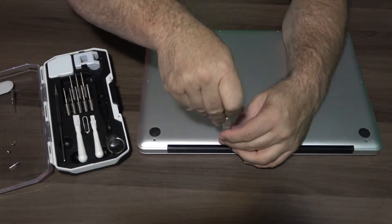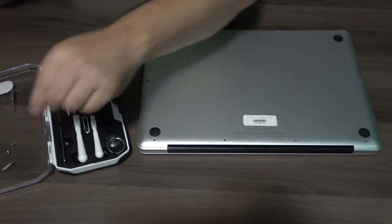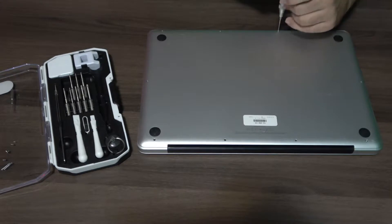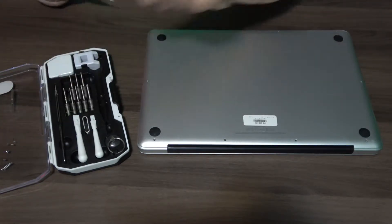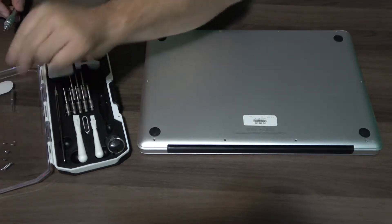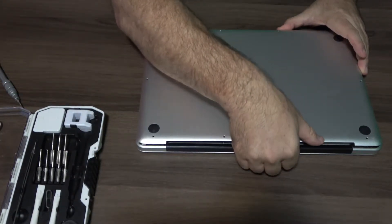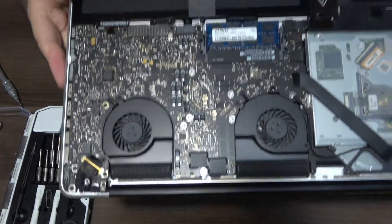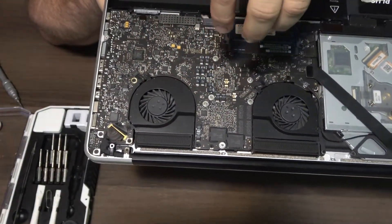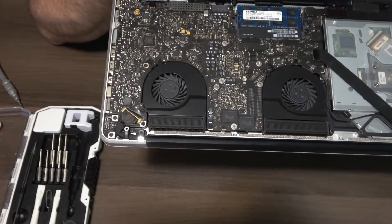Your back screws are your long ones and everywhere else are your short ones — you don't really have to remember much more than that. I love it when the GPU is on top of the board because sometimes then I don't have to take the board out if I can get a proper hit on it. But in most cases with Apple the GPU is underneath and the board does have to come out. There's your two fans and your whole entire motherboard right here, and the GPU is going to be either here or here.